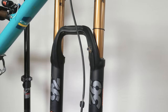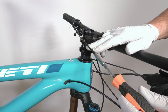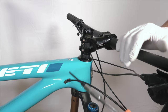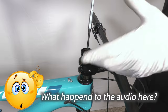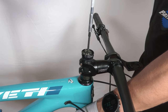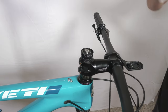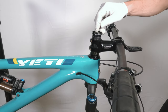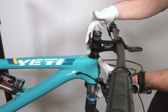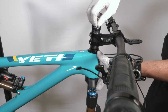Let's go to the top and take out the stem and the fork. We're going to start off by loosening the stem — you do not need to remove these bolts, just loosen them by one turn, maybe two turns max. That's all you need to do. Next, I'm going to loosen this top bolt, the tension bolt — this is what creates tension on the bearings. I'm not going to fully remove it yet because, depending on what type of headset you have, the whole fork might want to drop. So you definitely want to hold the fork on the bottom before removing this bolt. We can take this by hand now — just a couple of turns left.